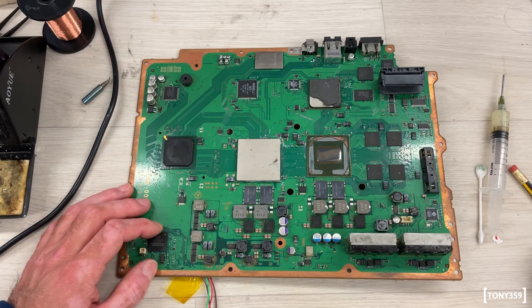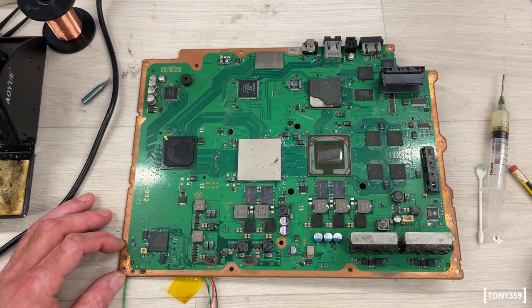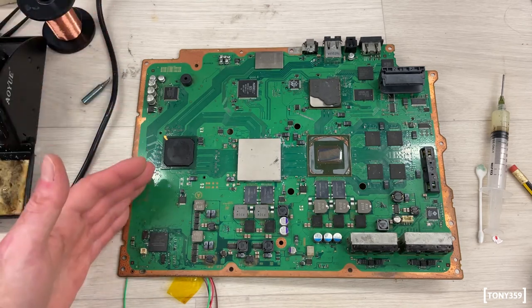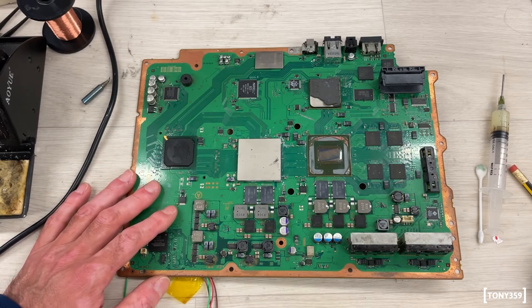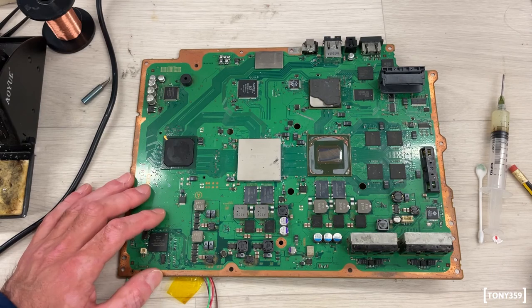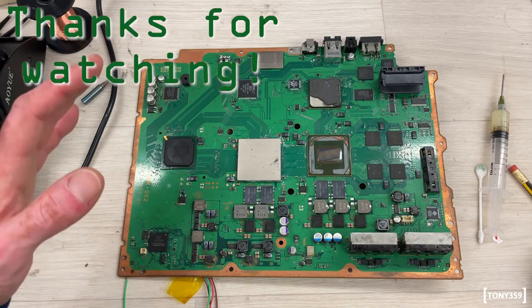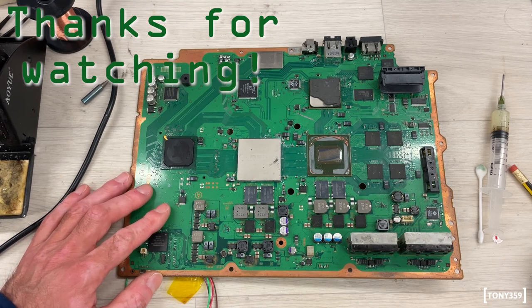This is kind of an important PlayStation - it's the one with PlayStation 2 compatibility. I feel like I failed myself. It's a shame because I fixed the power supply, I fixed the fan, and it was just a matter of removing the IHS and replacing the thermal paste. I'm sure some of you can understand how I feel. Anyways, that's the end of the video - I was totally not expecting to end this way. There's really nothing I can do on this PlayStation anymore besides replacing the CPU. Lesson learned. Let's move on. Thanks for watching, I hope you enjoyed and learned something from my failures as well.